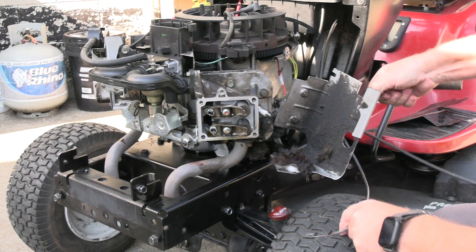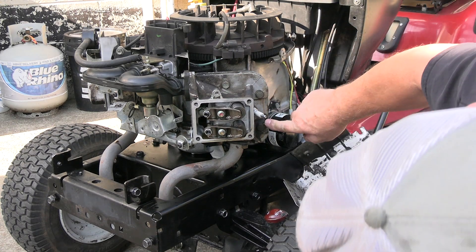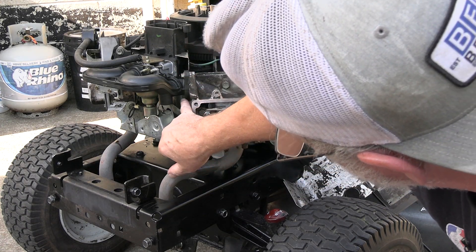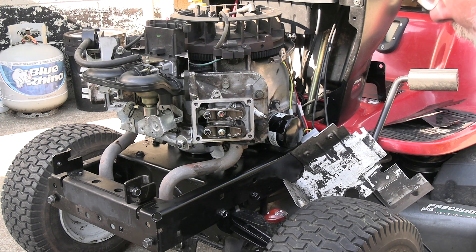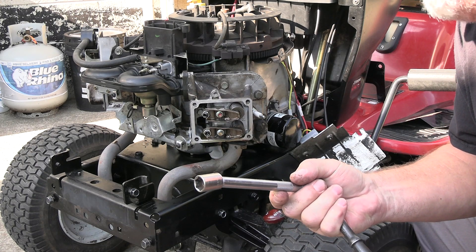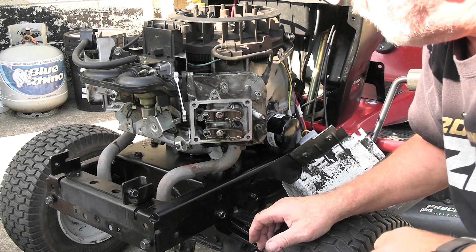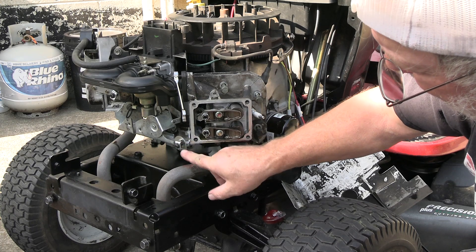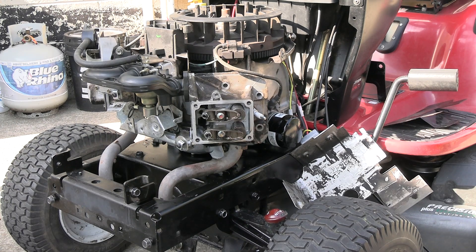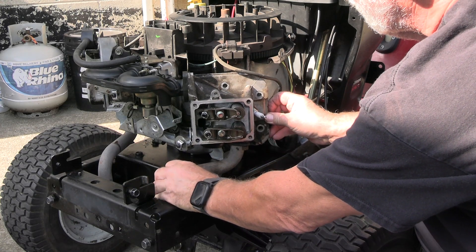This looks nasty — I'm going to get this out of the way and clean this up. I'm going to go ahead and remove the head. I've got to take out 1, 2, 3, 4, 5 bolts, and I have to remove this bolt and this bolt underneath here that goes to the carburetor manifold, and then my head should pop right off. I'm going to use a 6-point half-inch socket on these, and a 3/8ths inch wrench on these two bolts up here. There's also a bolt connected to the big brace that goes onto the head, so I've got to remove that one as well — it's probably a 3/8ths or 10mm. With all the bolts out, just grab it, hold on to your pipe, pull it straight out and off.